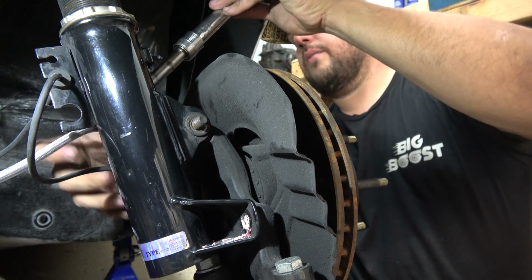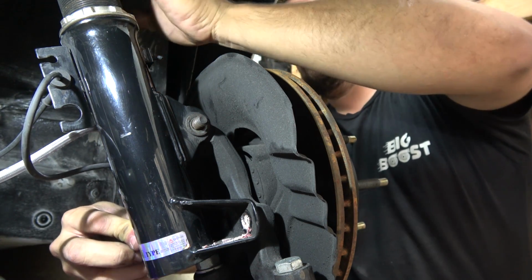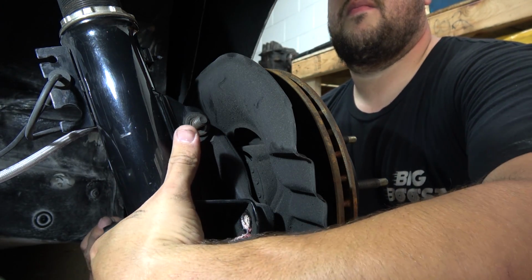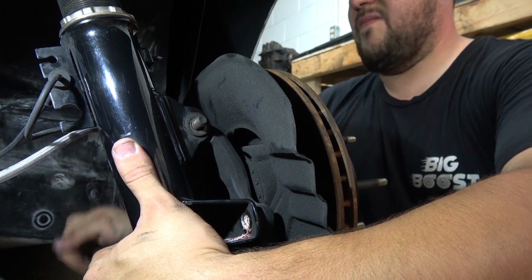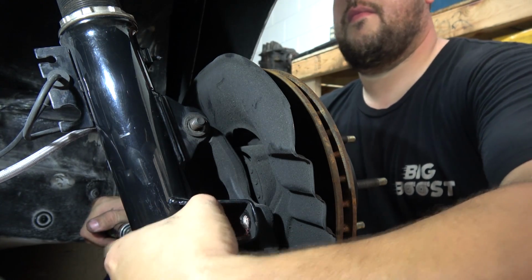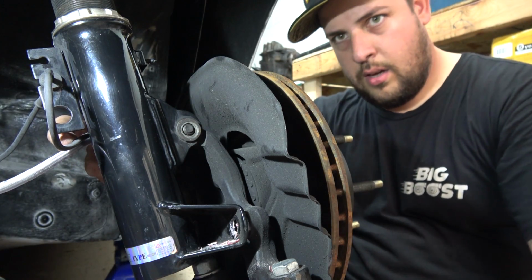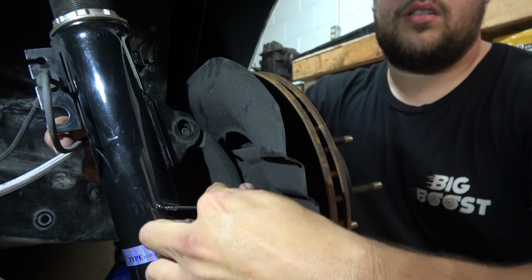Sweet. Going back to this, now I've got to get this back bolt from here. I've got to feel out for it because I can't even see it. Ow. I'm probably going to have to do this one like this. Alright, both bolts are out. I forgot to say that these use red Loctite on the bottom, so they are pretty hard to get off, especially that one was really noisy and hard. So I'll just wiggle this off and then pull the bolt and then grab the washer wherever it landed.